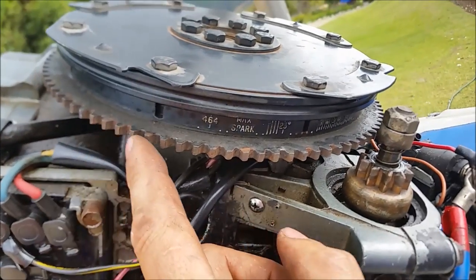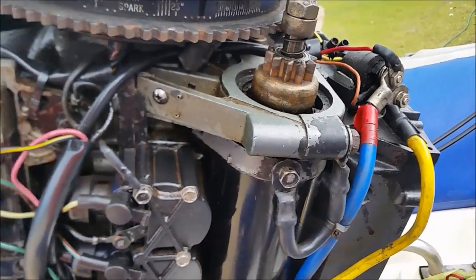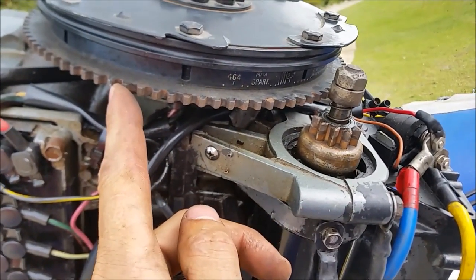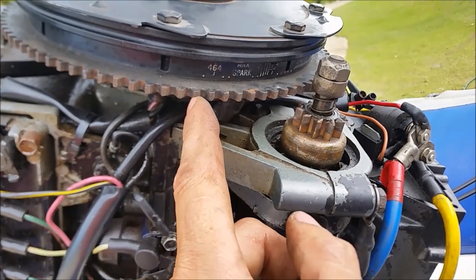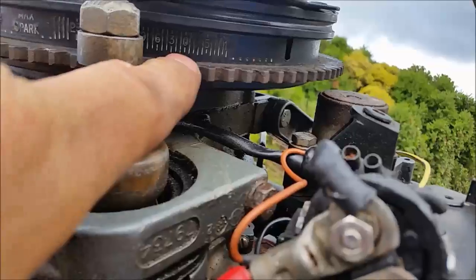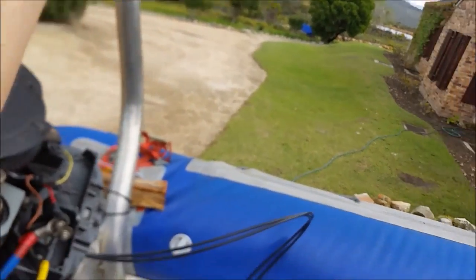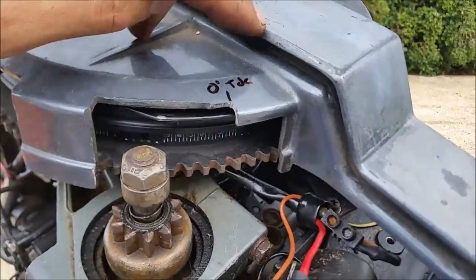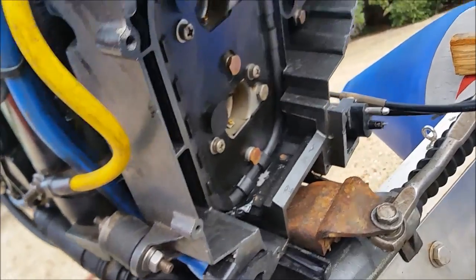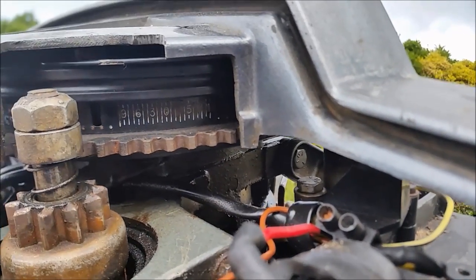In between these two marks you've got to count how many teeth there are. Triple check this — it is very easy to be out by an entire tooth. What you want to do is turn this, leave your wire, make sure you're not touching the wire. If you do, you're going to have to start over. You want to get your wire exactly between point A and point B, as perfectly as you can. When you have that, you go back and look for the zero on your flywheel — there's my zero mark. And that is your true top dead center. I've marked it and actually cut out my cover, and if I rotate the zero exactly in line with that mark, that is perfect TDC on my motor.